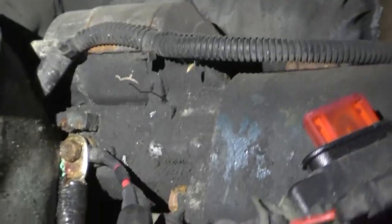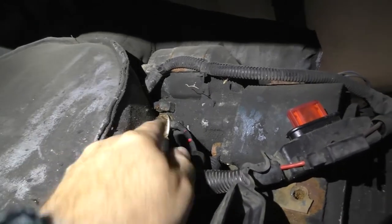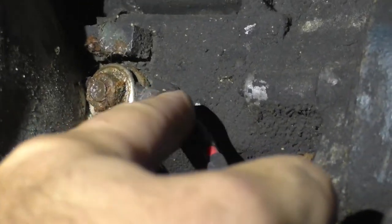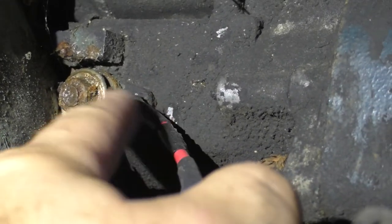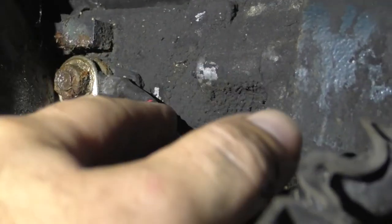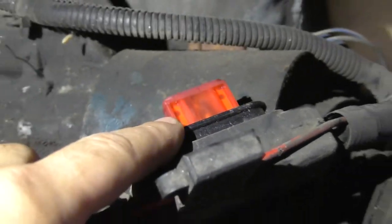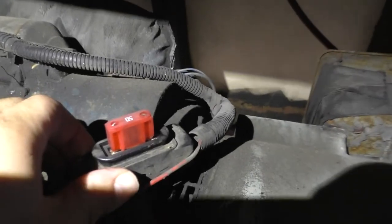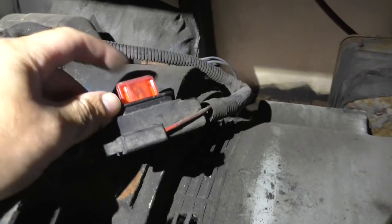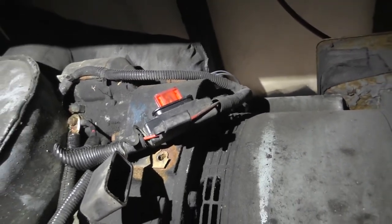This cable comes directly from the battery to the starter, and then this is what goes to your control box. The first thing to check is to make sure this isn't corroded off and has good contact. If your test light is dead, start right here. If that is good and solid with power, the next thing to check is what they call a maxi fuse — a 50-amp maxi fuse. That's the main fuse that goes to the brain. Between those three things, you will find your problem.